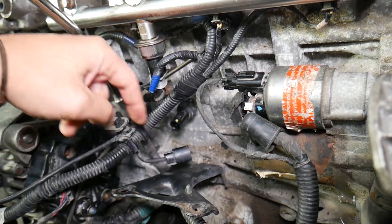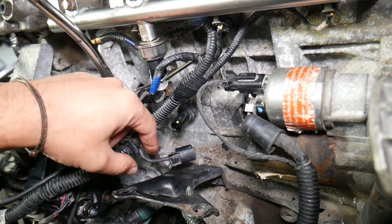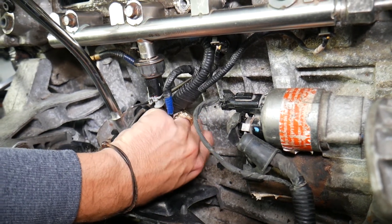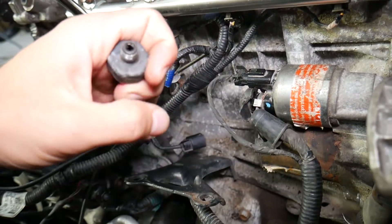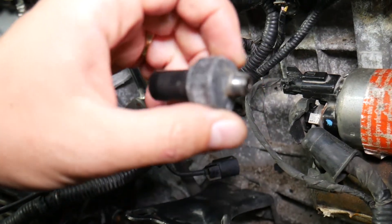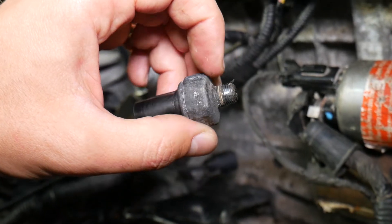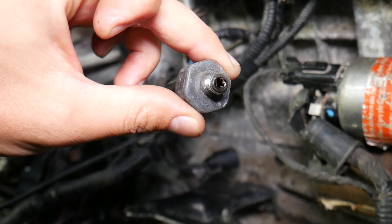Things to consider: make sure the wire is plugged in — sometimes people don't push it all the way in or the retaining clips aren't attached, and the wire can get broken. Number two, make sure it's connected. Number three, it could be a bad sensor or a dirty, plugged-up sensor. On the inside it could be dirty or malfunctioning. We have a special video explaining how to test an oil pressure switch, but I'd recommend going ahead and replacing it if you have that code. Never drive with low oil pressure because you will damage the engine.